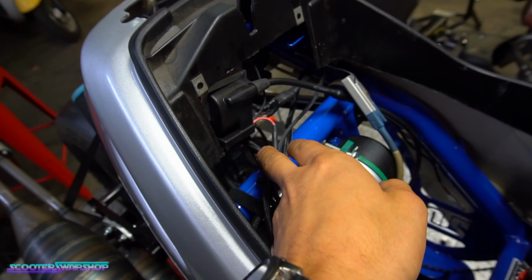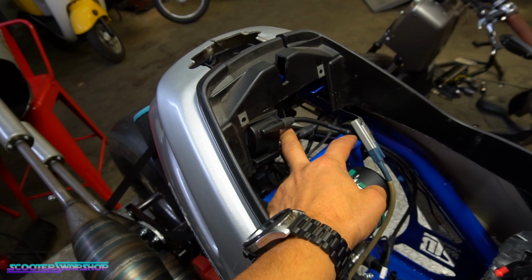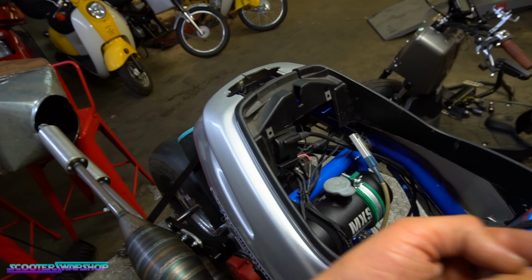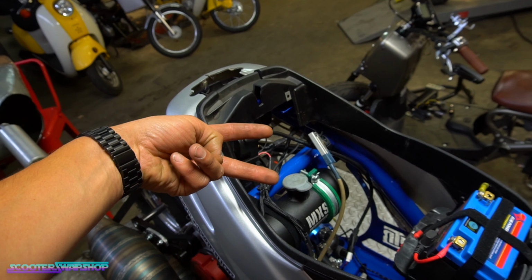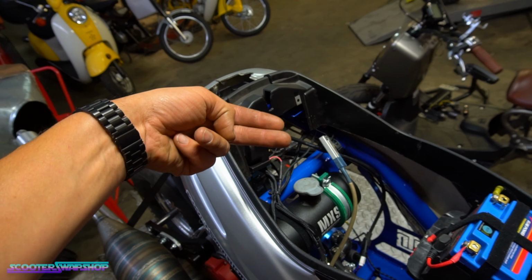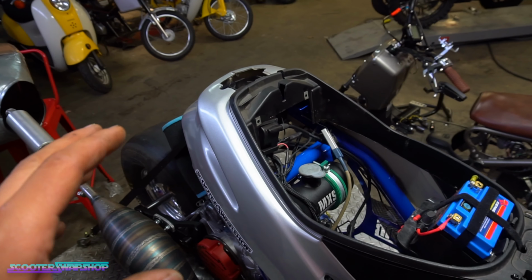Patrick is saying on the grounds, there's 2 individual coil packs, and providing ground is what kills them. Basically the 2 wires coming out of the ignition, we just teed them together and then went up to one switch and back. There are 2 feeds that come off of the ignition systems, and if you bring them together, it automatically kills the motor. But it only kills the motor while it's running. It won't let you start it. Once it's running, it doesn't kill it. Exactly. It's really weird. So you flip the switch and then it kills it.